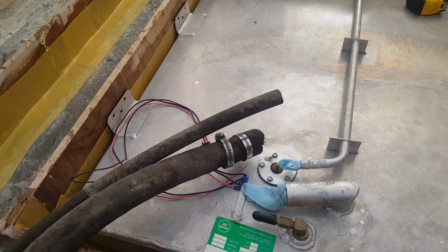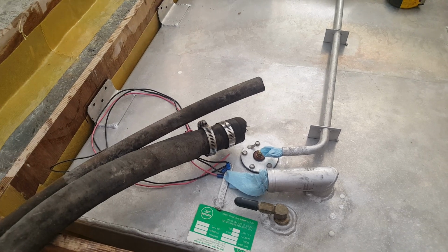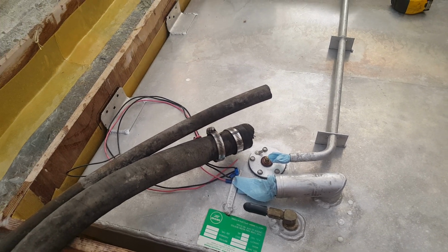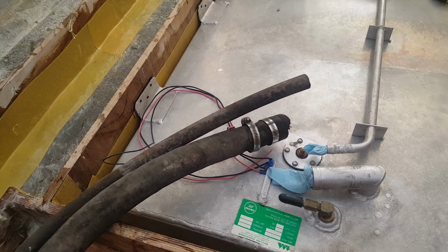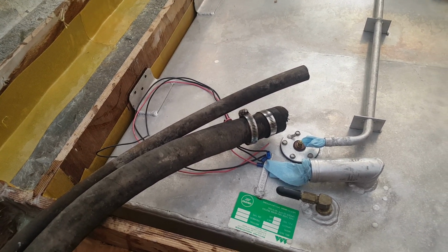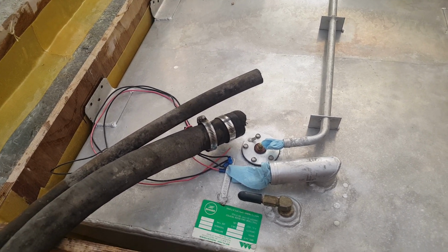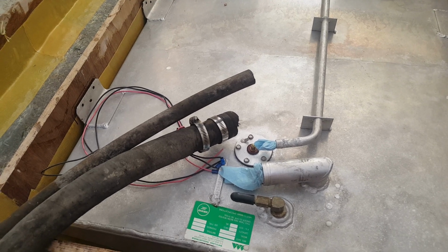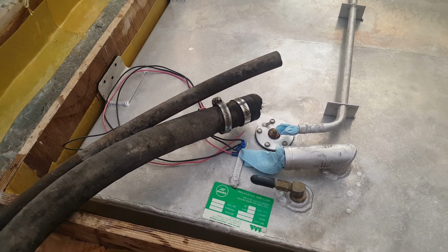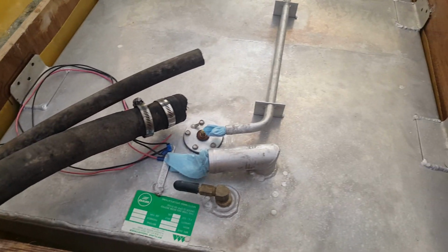That's something I talk about in my carburetor video, where we actually have to go in and replace all the old seals, because of course it cracks when people start using the newer upgraded types of fuels that have ethanol in them. And we're not talking E85, by the way, because most boats aren't designed to run on E85 anyway, but the ethanol nonetheless, alcohol, will dry out these hoses.